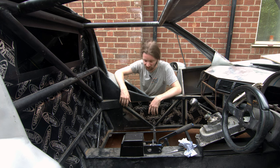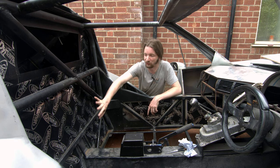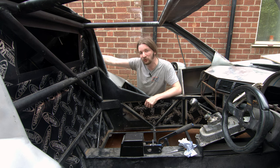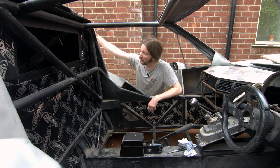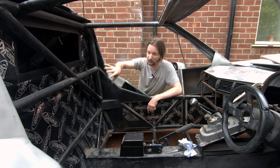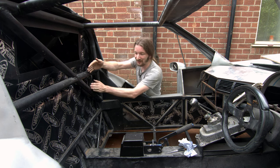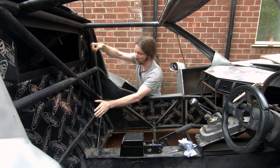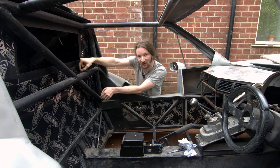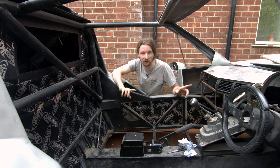That's about as easy as it gets — a nice single flat panel with no curves or complex shapes. Everything else on the car has been a lot trickier. The firewall looks like one big piece of metal but it's behind the roll cage, and everything I did up in the E-pillars is even more horrible. The trick for awkward areas is to peel the backing back partway, slot the whole piece down carefully, then peel the backing the rest of the way from behind. In the E-pillars I had a tiny triangle to pull from, but it did work out.